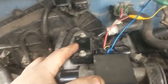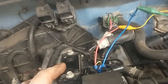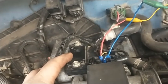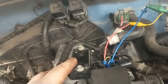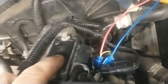This truck's a 96. Everything's all original on it. So it's not far-fetched to think that fuel pump was shot. Of course, it's a 96 S10, so they don't have a test port for testing fuel pressure, and I didn't feel like buying a whole bunch of expensive fittings to test it. So we did the pump, the fuel pressure regulator, which is here, and we put a new fuel filter on it, which was pretty much plugged, by the way.